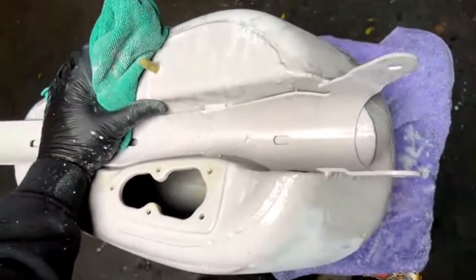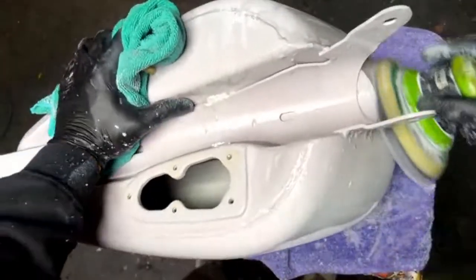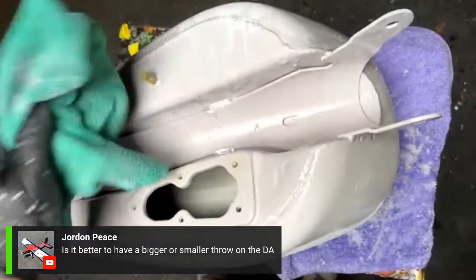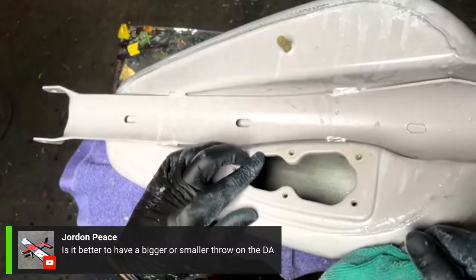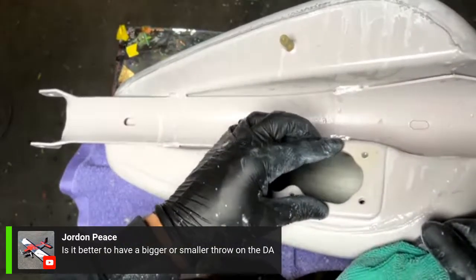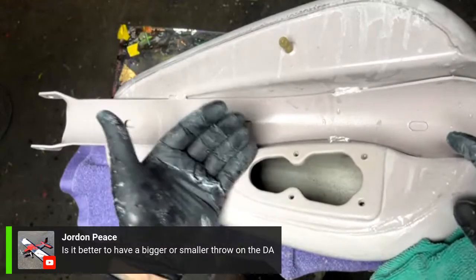Looks like I'm finishing up the last of this because we just got a little bit here on the front. We're just about done. That's looking good. One thing I want to point out is that before I go into paint, I will scuff this all down. I left this open for the time being because I didn't want primer all the way over the metal. But once this goes into base coat, this will get masked up right here and trimmed out. That fuel pump needs to go up in there, but it needs a smooth surface. I like to make sure there's primer there, because if you have an edge and cut it off in the wrong spot, the gasket may not lay right.